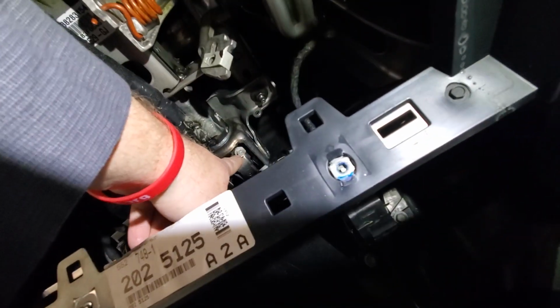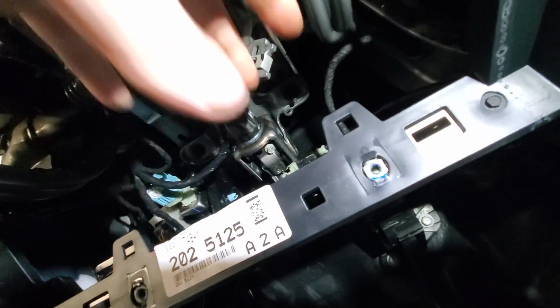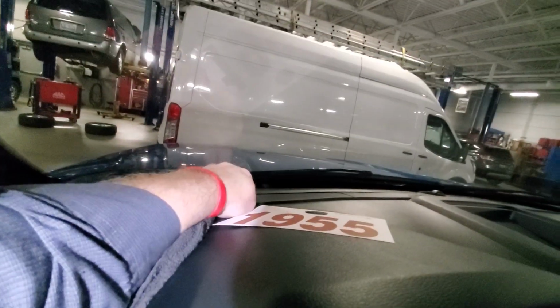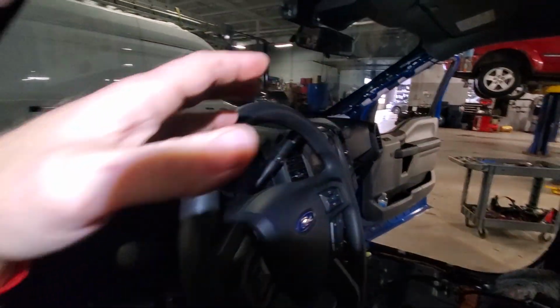And then you have to get down here and pull this bolt. The bolt has to be pulled out of there so you can disconnect the steering selector upper from the lower. So when you go to pull your bolts here, here, here, and then there's a bunch of bolts underneath the plastic cover on this side. I think there's one, and then over there under the plastic cover there's two, and then this whole thing's ready to start sliding out.